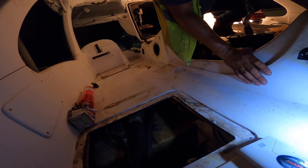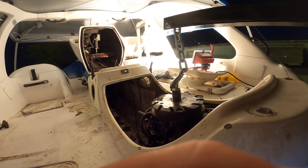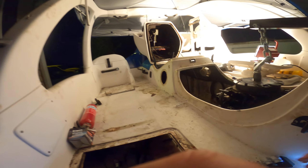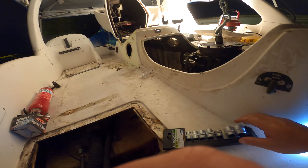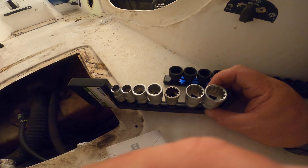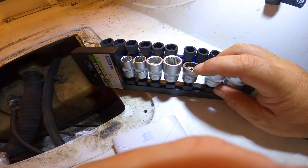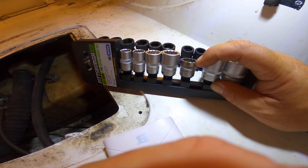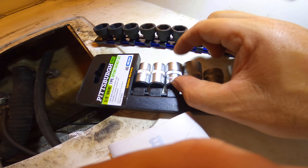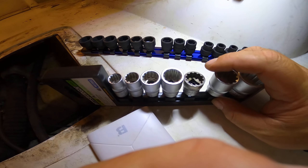Let me grab the sockets and show them. So I went to Harbor Freight — Harbor Freight's great for disposable tools you can ruin. They're 15 millimeters, and as you can see here, I partially stripped it trying to remove it with a crescent wrench. Since it was partially stripped and not totally destroyed, I decided to go with these — spline sockets, 12-point. They do 12 and 6 point, all that good stuff.